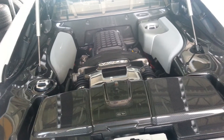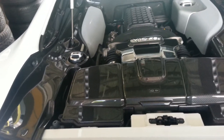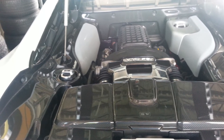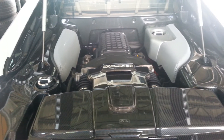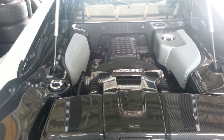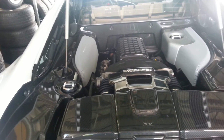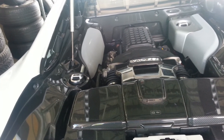When you guys were doing the fine tuning on the software, was that being done through the port? Yeah, we didn't do much fine tuning. We pretty much took it out and just looked at all the measuring value blocks for the fuel pressure and timing advance, making sure that when we were driving it, the timing advance was advancing to the right amount of degrees and then going back down. We were checking the fuel pressure to make sure we had enough on load, and the duty cycle of the injectors to make sure they were correcting for the more air the supercharger was putting through. So he was basically just reading measuring blocks from the OBD2 port and making sure the tune went through correctly and was adjusting it to what it needed to be.